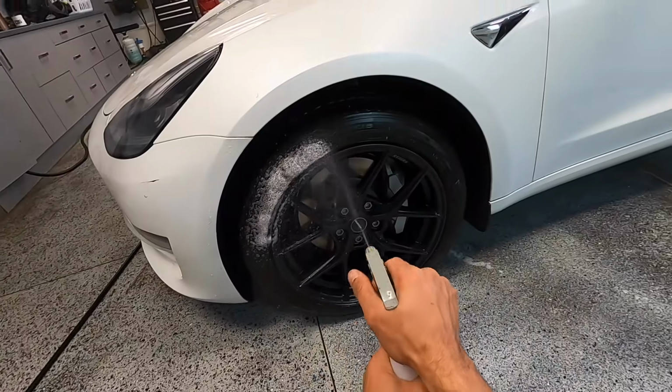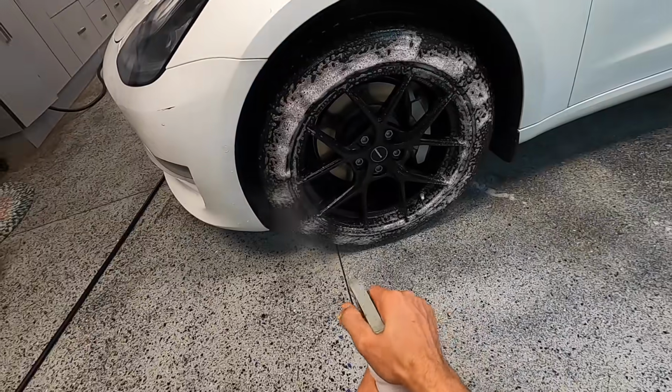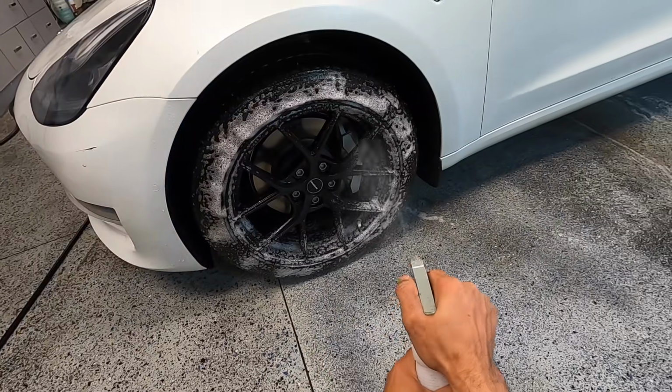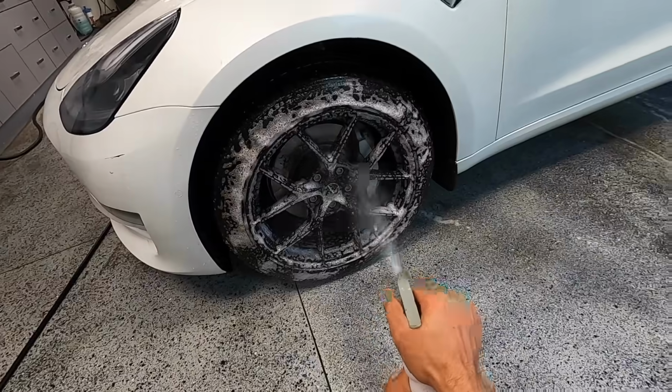Starting on these dirty wheels and tires now, and I'll get some of my non-acid wheel and tire cleaner sprayed on, and we'll then agitate with my Detail Geek contour tire brush, wheel brush, and boar's hair detail brush,